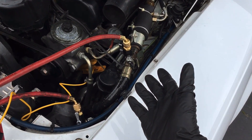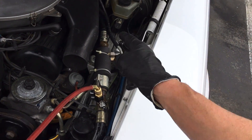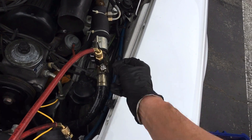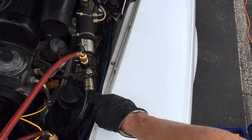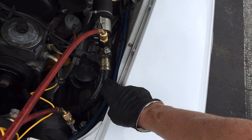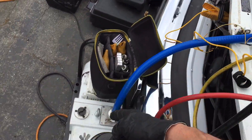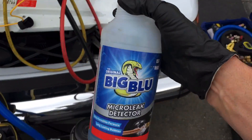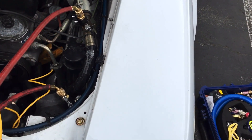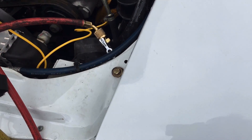We have original hoses. Check your low-side pressure hoses when the system is running and cold, because sometimes leaks develop only when it's running — the metal gets cold, it shrinks, the rubber is no longer elastic. It starts leaking at one of the seams where the crimps are, or in the hoses under pressure. You might not see leaks coming out because there are tiny little holes made in the skin of the hose. But when you hit it with bubble solution and put it all over there, you'll see bubbles just pouring out. Turn the system off, the pressure raises, it gets warm, and the bubbles stop.